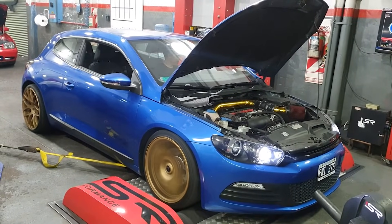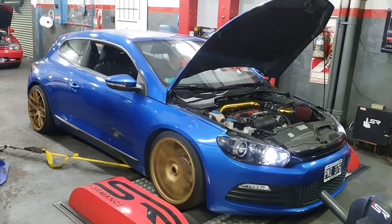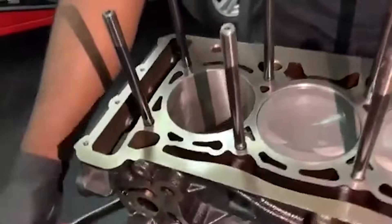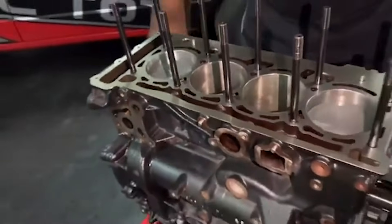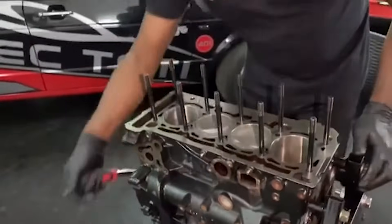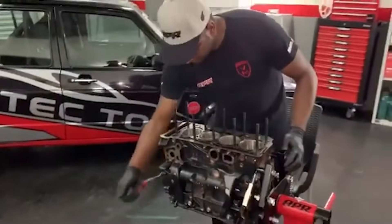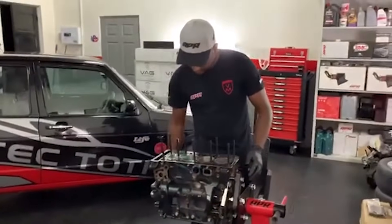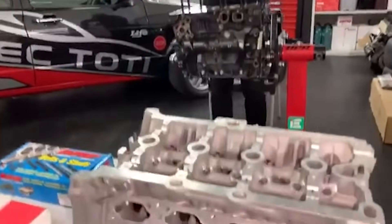I have seen some people pushing it higher, but at that stage you are asking for a piston to say goodbye. Uprated internals including connecting rods, pistons, valves and valve springs become necessary to handle the increased power levels. Custom work and machining may be required and costs rise considerably — but with a nice big turbo and a fully built motor, you could make a reliable 600 horsepower.